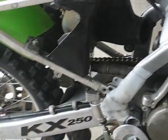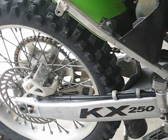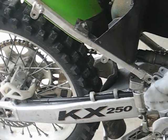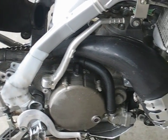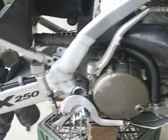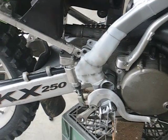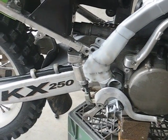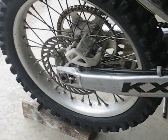On that note, it's also really important to clean the bike really well before you work on it. I cannot stand working on a dirty bike because dirt gets everywhere. I don't even use a power washer because I've seen so many bikes where they use one, it blows past the oil seals, especially into the swing arm bearings. They rust out — out of sight, out of mind.